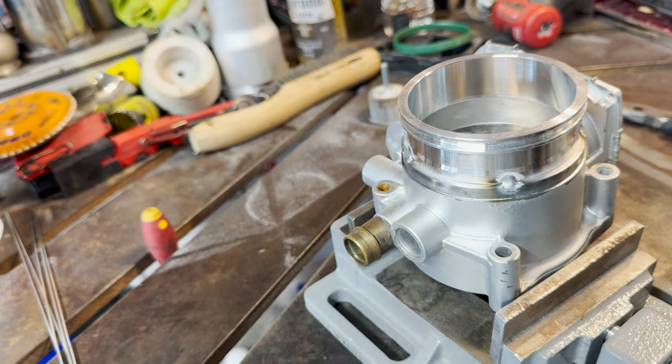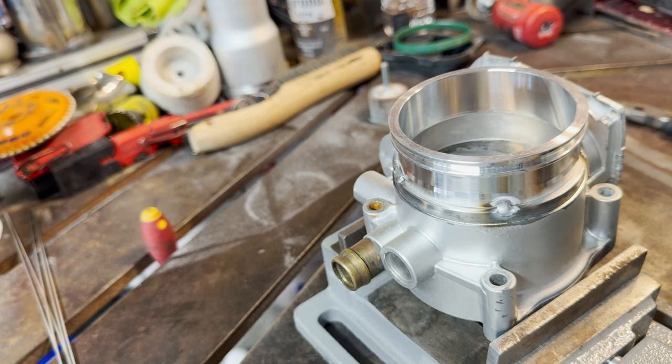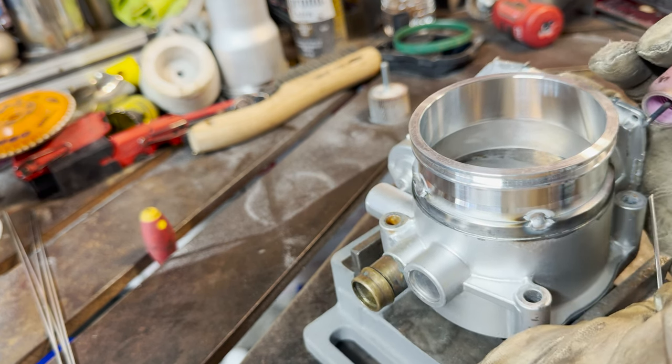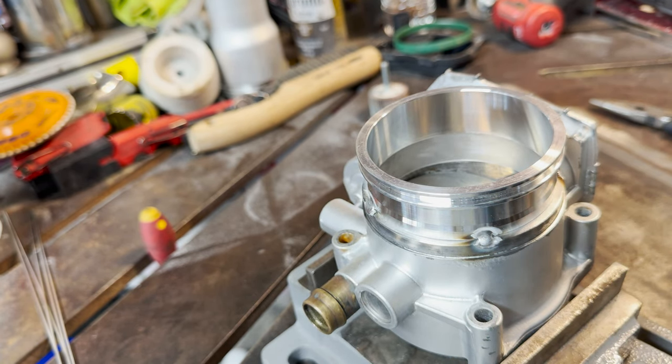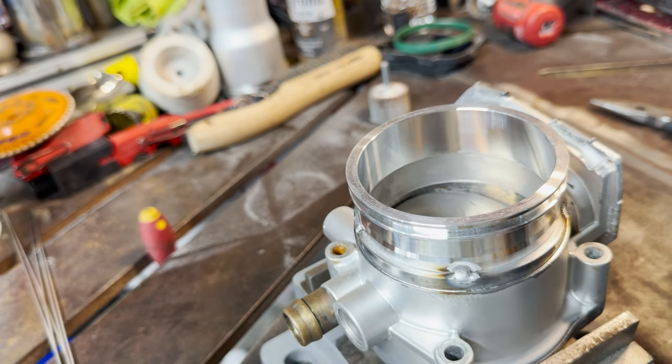All right guys, so she's cooled down. I have a little metal fan that I just set it on. Let it cool down. It takes about 2 minutes. She's still a little warm. You want it to be a little warm, because remember, aluminum does not like to weld cold. So let's keep her going. Actually, you know what? Let's clean off that soot a little bit so we can have a nice fresh start again.